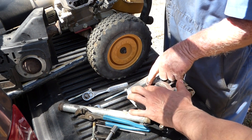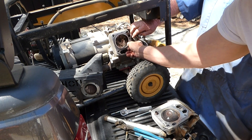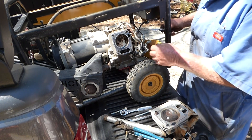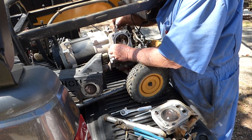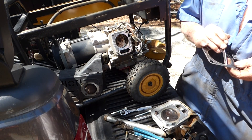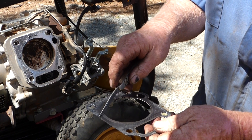See right here where this dark place is? Look at this gasket — it's pushed out right here. See how this gasket's narrow right here and pushed out right there? I think it may be the gasket. You may be able to put a gasket on this thing and fix it. So just a head gasket? It was sealed on the bottom side, but it looks like it's blowing by on the top side — the air's been blowing by on the top side.